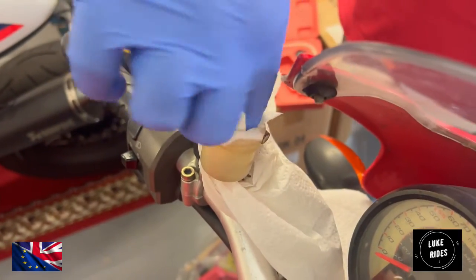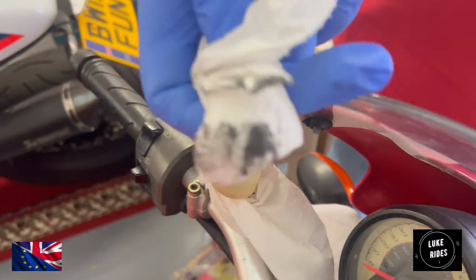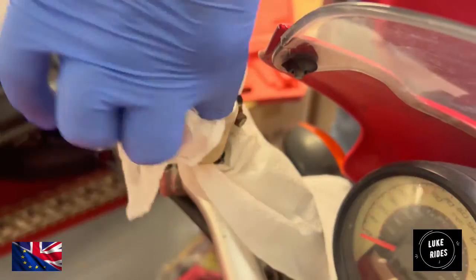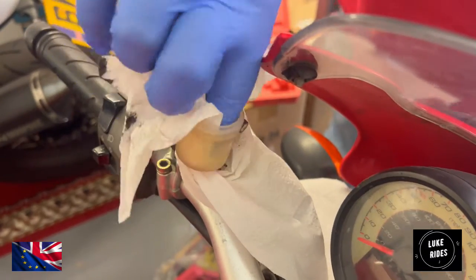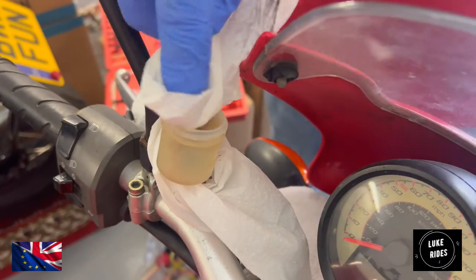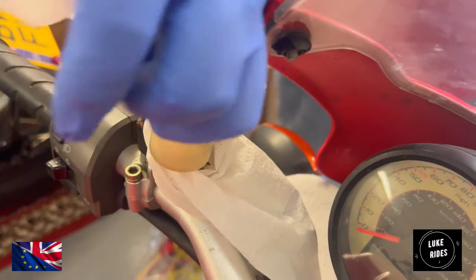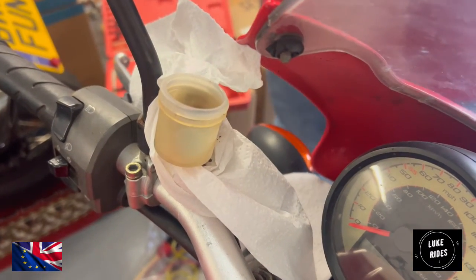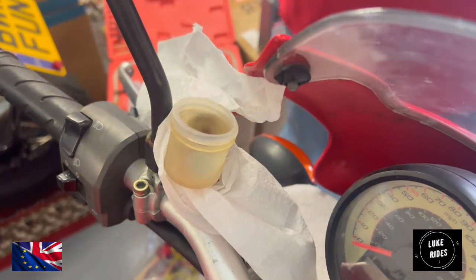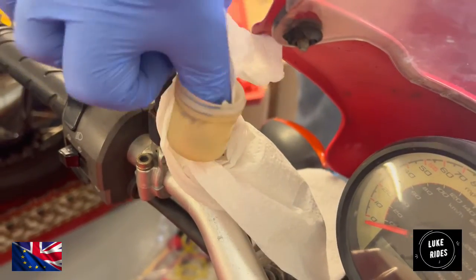We don't know this motorcycle. We're only just getting to know this motorcycle, and that is why we are giving it special attention, because we want it in the family to boost. But no matter whether something's got full service history like this motorcycle has, you've got to wonder who forgot to change the fluid, how long ago was it. So if you're buying a motorcycle in the future, it's definitely worth looking into whether clutch fluid has been changed, whether brake fluid's been changed. A lot of people just think an oil and filter is a service.